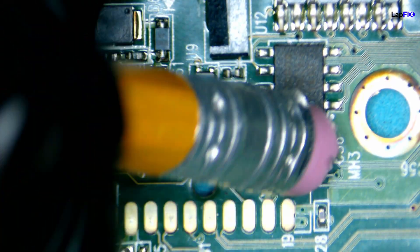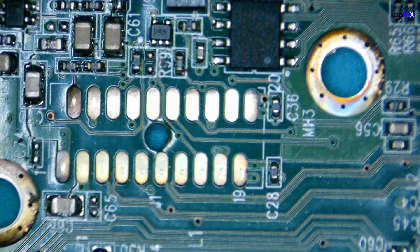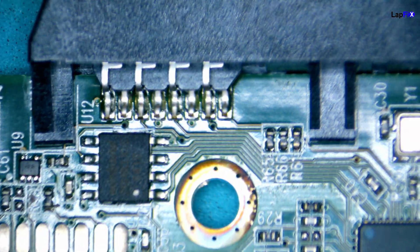You can see how it lightens up a little bit. There's only so much this can do, but it's useful if there's an obvious connection issue. The one in the corner looks a little bit bad, but the main pin in the middle on the top left looks like it was making good contact. We go ahead and scan the board — looking for anything out of place, damaged capacitors, something blown, liquid spill. It doesn't really seem to be the case. All these pins actually look to be okay.